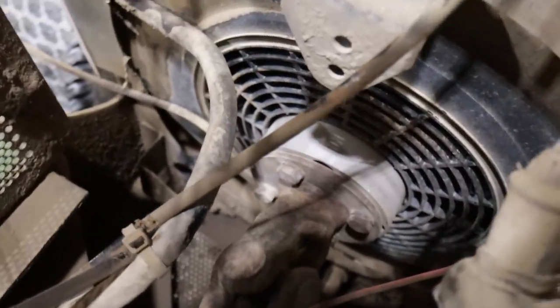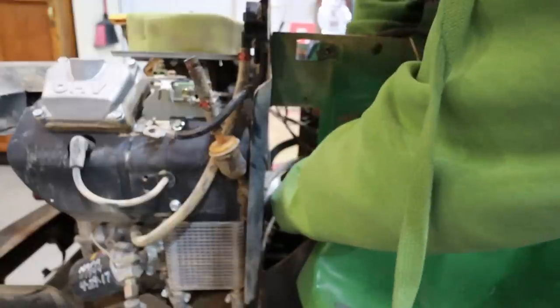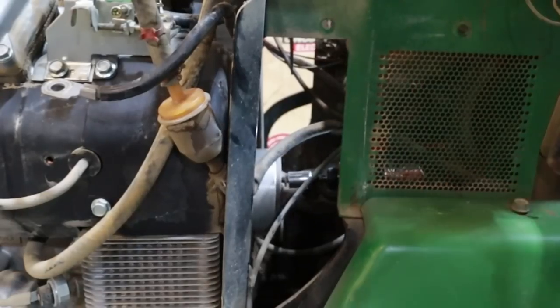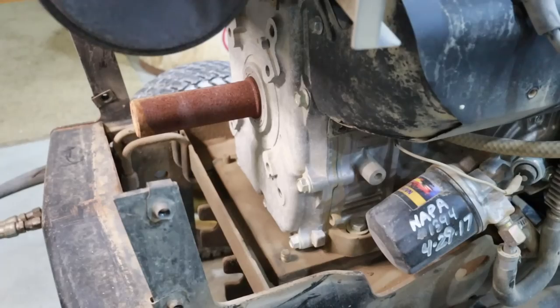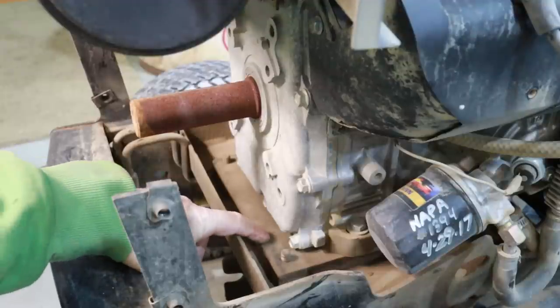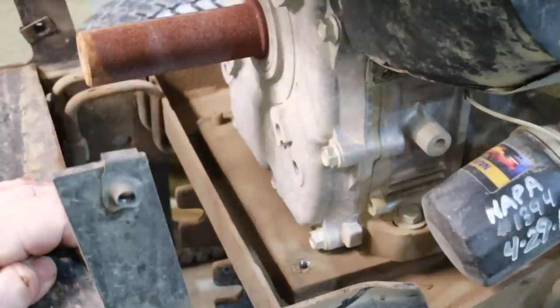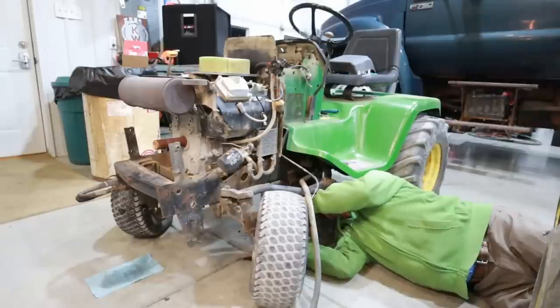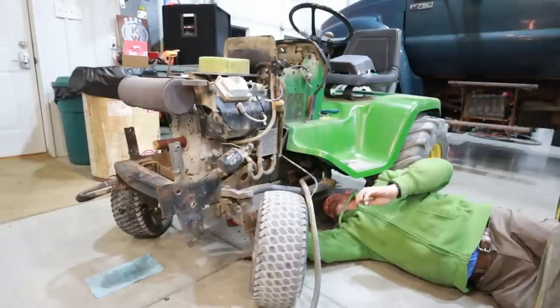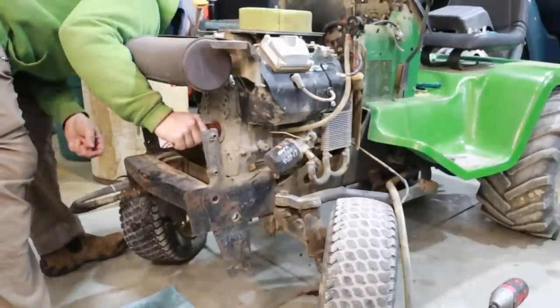There's the driveshaft connected to the back of the flywheel — that's the custom piece I had made. I'm just going to knock those four bolts out and I'll have that loose. Four out of four. Now it's time to take the four engine bolts out of the bottom. This is the riser plate I made to raise the engine up to line up with the driveshaft. I drilled and tapped these in the riser plate so I could put the bolts in through the bottom and thread them in. Let's give it a wiggle. Easy peasy.